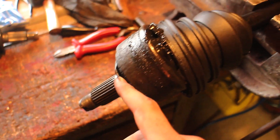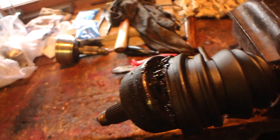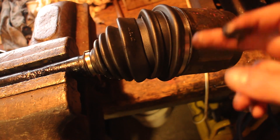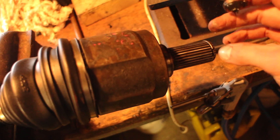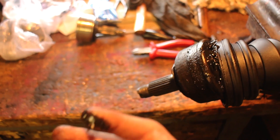Quick guide on how to get the outer joints off on a Honda: this is the main part of the bearing right here. You're just gonna use one of these punches - put it on there parallel and smack it with a hammer so it jumps over the safety pin inside. For the inners, you have to clean the splines off, there's a safety pin you have to take apart and remove, and then it comes off. For this one, just smack it off.